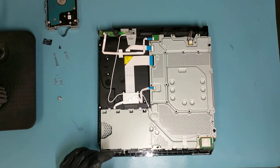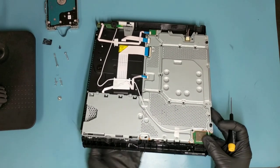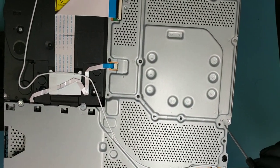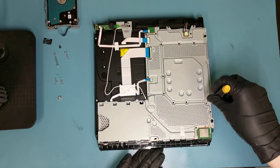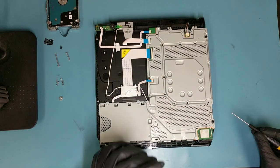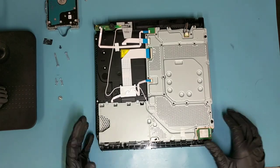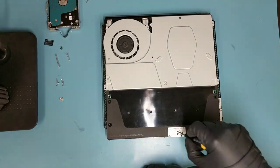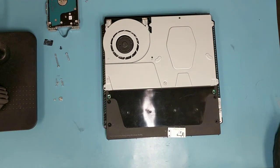Now here you don't need to take any of those screws out. The only screw that holds the power supply in place from this side is this screw right here — it's the second one from the edge. Just take this one out and keep it separate from the rest because it's a different size. Go back to the front side. This screw is also a different size from the rest of them, so pay attention not to mix them up.